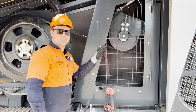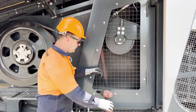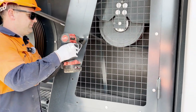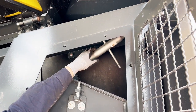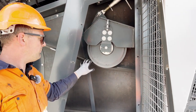To do an adjustment on the tensioner we need to remove the bolts that cover the tensioner. Once we have access to the tensioner there's a tensioner bar up here, we can then adjust that to get our correct tension on our belt.